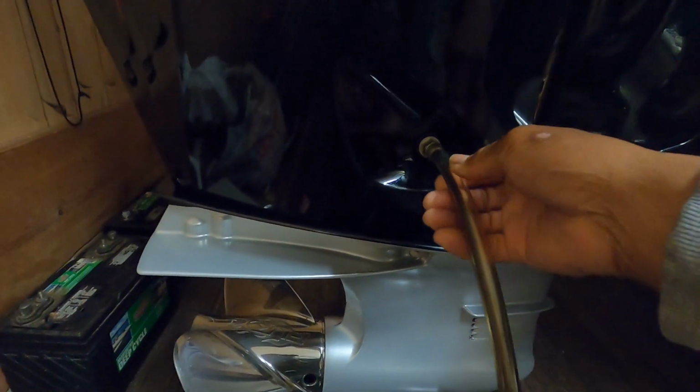Now we're back down at the drain plug, and as you can see, it's been draining for a while, and it's all drained out, and we're ready to remove the tube, like so. And you get your socket ready again, and you just want to snug this back. You don't need to over tighten it. Just tighten it. There you go. Like that. And it's all ready to go.